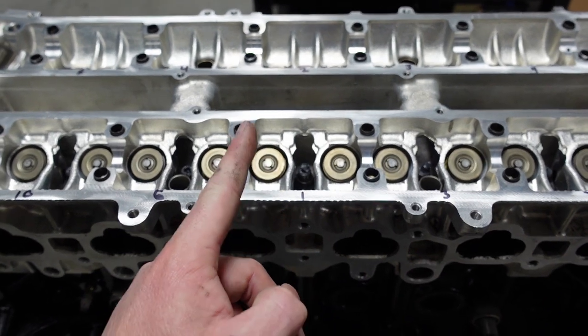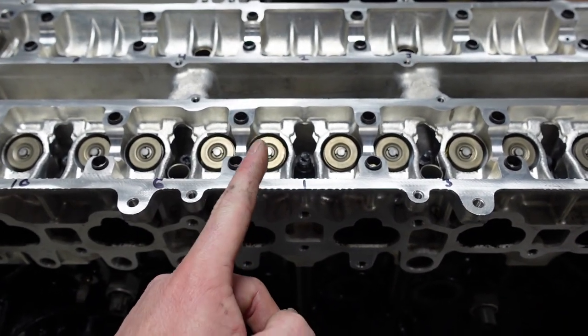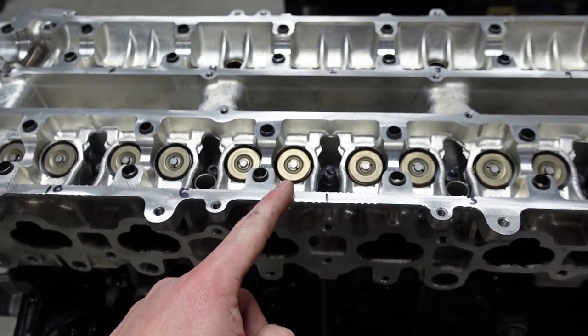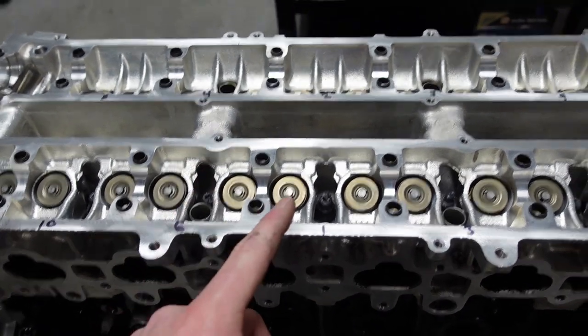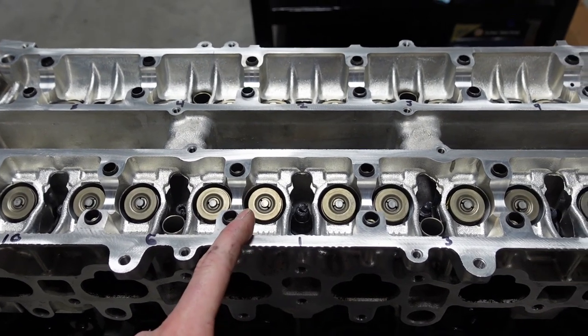We're gonna go a little bit past that because I wanna make sure this head does not lift off. I always go to 85 just to get that little bit extra. It won't hurt. You can go up to 100 foot-pounds. If you look online, I think they say 100 now for some of their studs. We're gonna be going to what the book sent us today. In the actual description, it said 80 foot-pounds. We're gonna be going to 85.